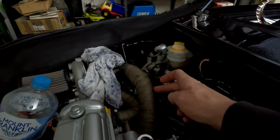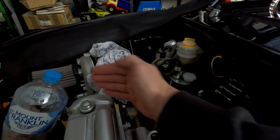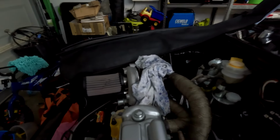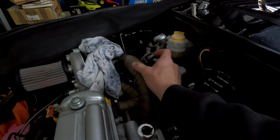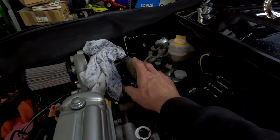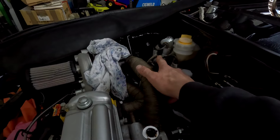If we cut that down there and then re-angled that pipe, and then same with that one there, and moved the whole turbo forward, got a smaller K&N air filter, or K&N style air filter, then that would work perfectly, because then all we really need is probably 3 to 4 inches between the downpipe off the back of the turbo, or the dump pipe, I think they call it nowadays, and these pipes here.